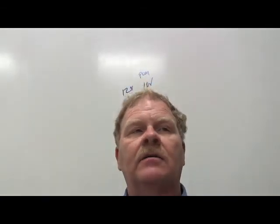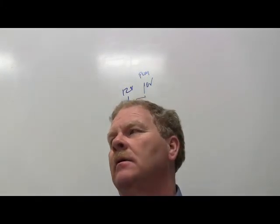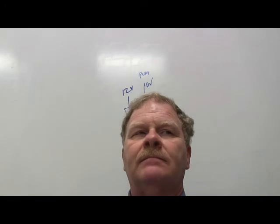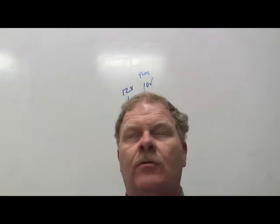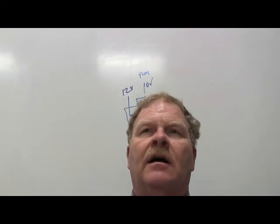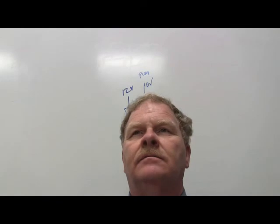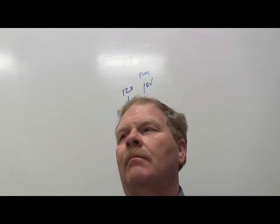Okay, incidentally, what can fool an oxygen sensor into giving a false lean or a false rich signal? Give me an example of it. Anybody know? You told me this the other day, and I don't remember. The catalyst? Not that one, because the sensor we're talking about is in front of the catalyst. But what if the oxygen sensor signal wire is rubbing against the block somewhere?